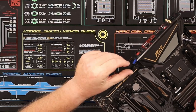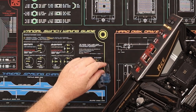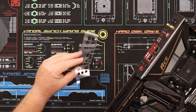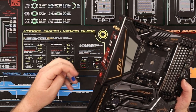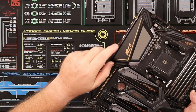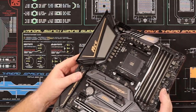With the newer motherboards these days, guys, you'll see that the I/O shield is actually pre-installed, which is good. Because on the older motherboards, that comes separately and you've got to fit that into the case, which some people do forget. Then when they build it up, they realize when they turn it around, there's no I/O shield cover on the back of the case, and they've got to rip it all out again and then put that back in. So it's a handy bonus, which is good.